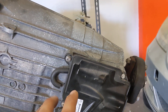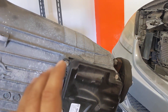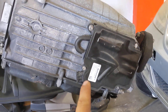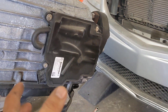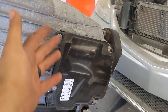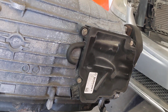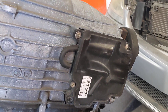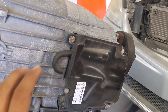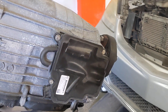To fix the ISM module, you don't have to pull out the transmission to replace it. You can see where it's seated between the engine and transmission, and it can be done from underneath the vehicle. It's going to be a little tight without a lot of space, but it can be done without pulling out the transmission or the engine. We're showing it here since we have it out for another purpose.